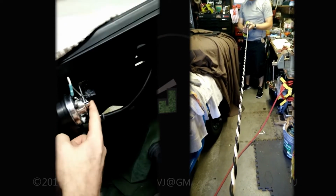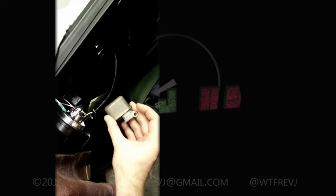We've got the loom here running all the way. You can see it's unshielded in one little area there. We twisted our own pairs. We've got the wire running all the way here, around the front. The stock horn was dead, so we threw a replacement in and got rid of that ugly combination relay here. Is that thing still over here? Got rid of this ugly combination horn relay here and just ran this relay.